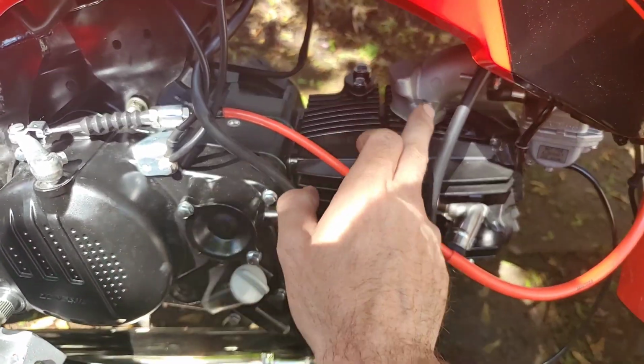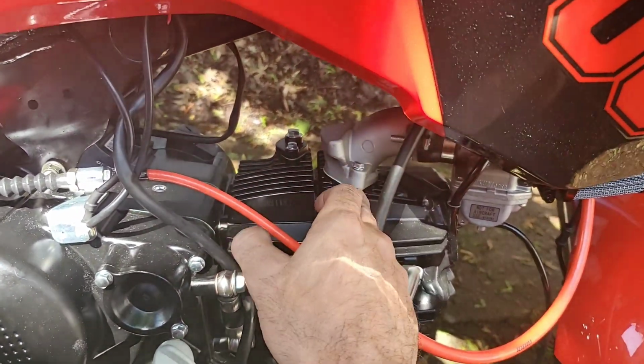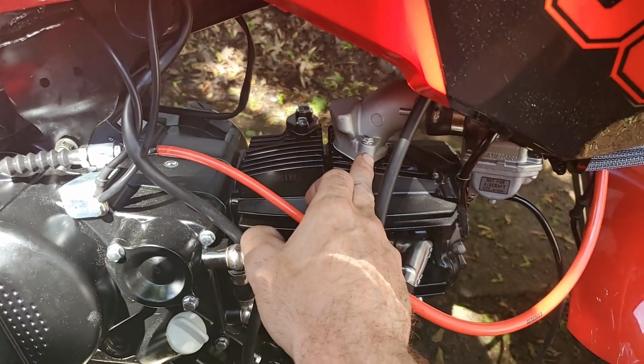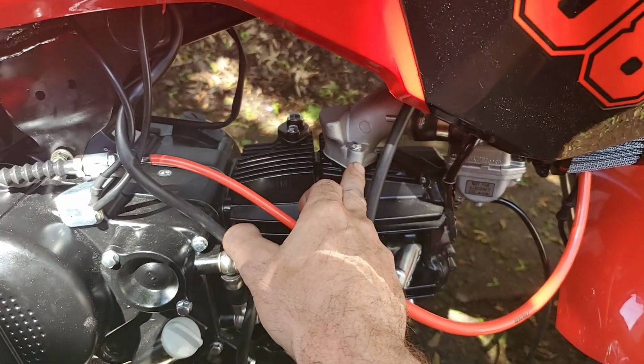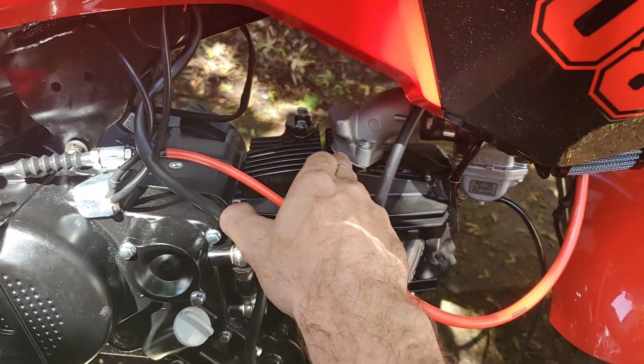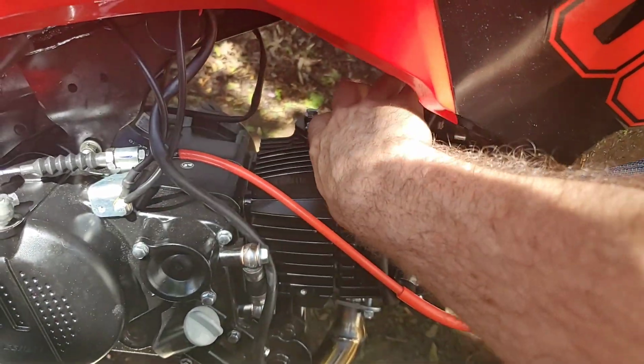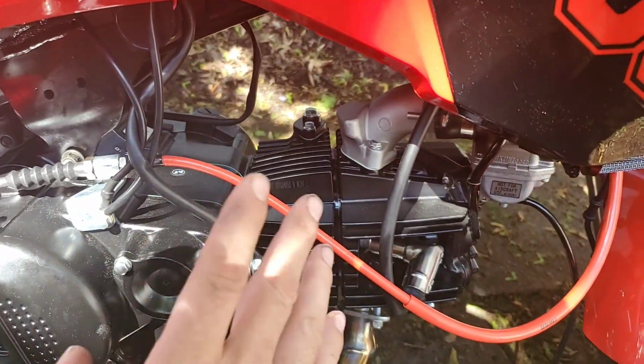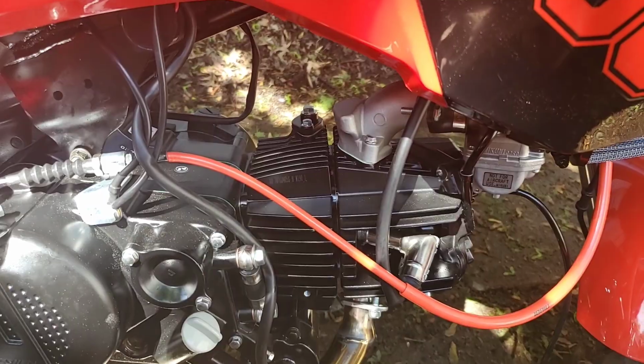You know, I got mine mounted forward. I'd actually like to turn this intake, so I haven't ordered the, they call it a clocking flange for the intake manifold, where it's got a ton of holes right here, and you can basically move the intake any which way you want. So I'd say you're probably better off getting that too.